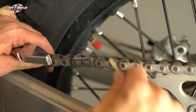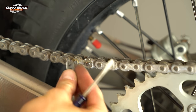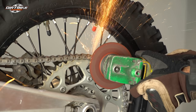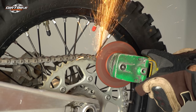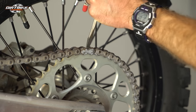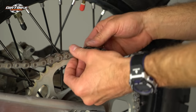I'm not going to take any special care removing this master link clip because I'm not going to reuse it — I'll use the new one that comes with my chain. So I'm just tearing this off and bending it with a screwdriver. They make a chain break tool, which I have, but I also wanted to show you that you can grind the faces of these rivets right off, because the master link is pressed on on these bikes so you can't just pull it apart. You've either got to press those pins out or grind the face of the pins off like I've done here with a little four-inch grinder. Then you can just wiggle this thing and pry it off easily with a hammer and screwdriver — it'll just pop right off once you've ground the faces of those pins off or pushed the pins out with a chain break tool.